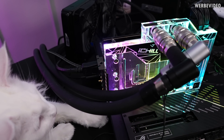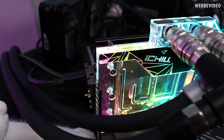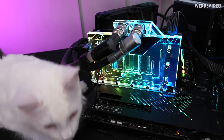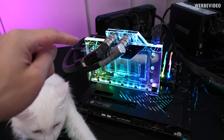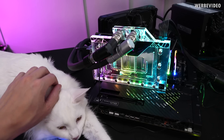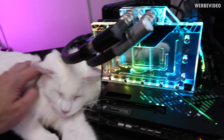It seems like a lot of the water is just exiting right through here. That's something I noticed. I'm not sure if it will have any kind of negative impact on the cooling performance, but it just looks like a low amount of water dripping through there. Just pump speed-wise, it should be enough — it's a D5 sitting underneath the table that's powering the Mora, and this is pretty much running at about 100% fan speed, so just from the pump it should actually be sufficient. And we can also see that there's definitely some water flowing through there, so that should be fine.